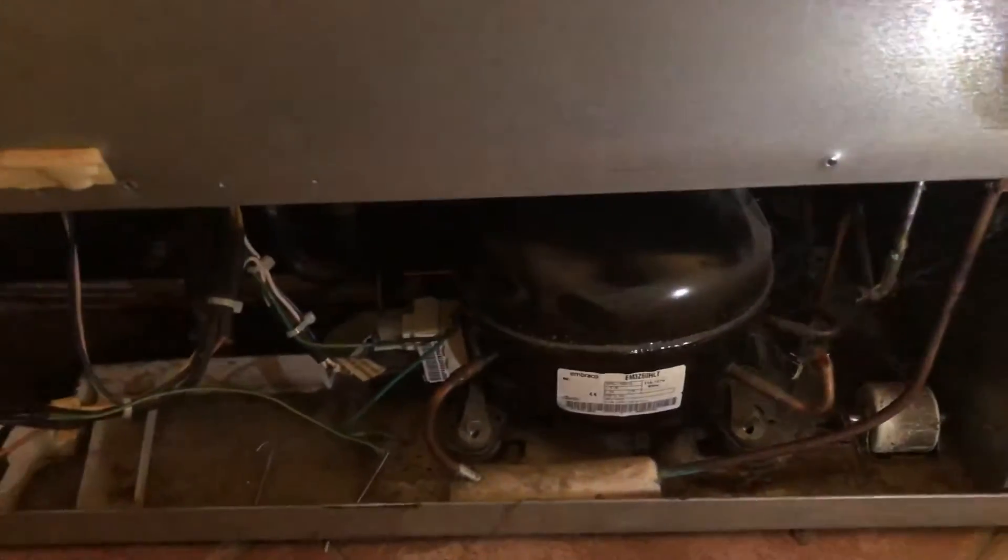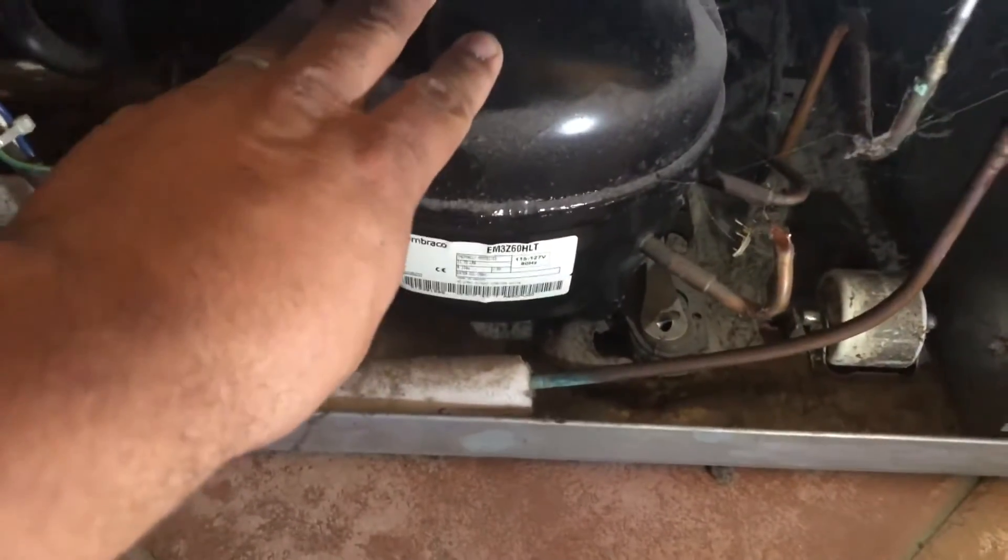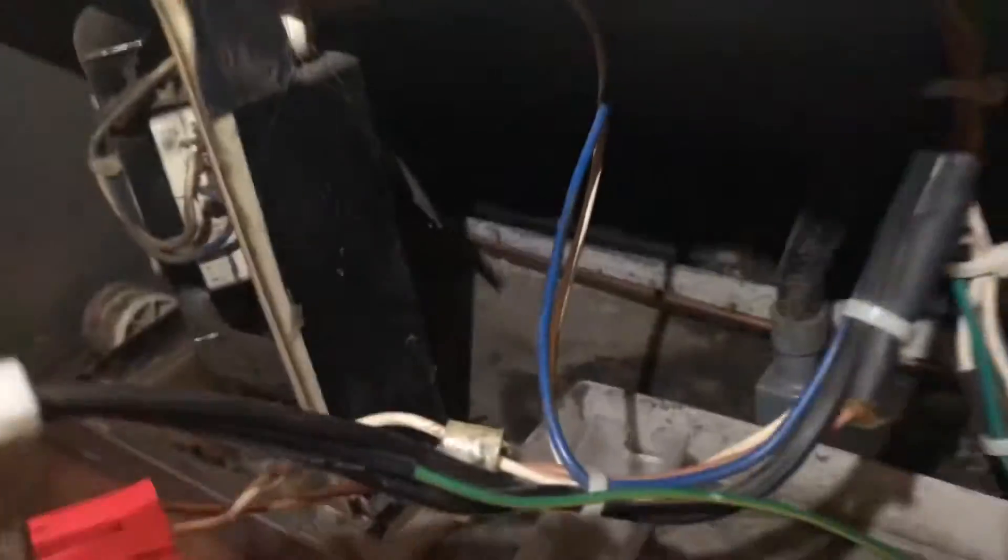Sorry about the light — it's going to be very tough here today. But the first thing you want to do when a refrigerator is not cooling is check under here for the compressor. This has a couple of quarter-inch screws. When you get down in here, you'll notice the compressor is not running, and another observation is that the fan down here is not running either.